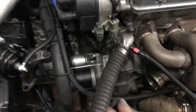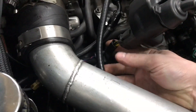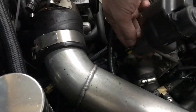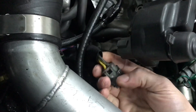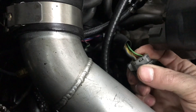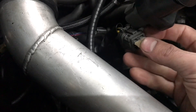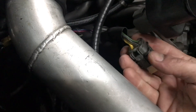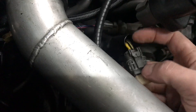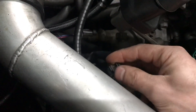Essentially what we're going to be doing is disconnect these two plugs here and disconnect the distributor. Back here there's a plug for your coil and you have to disconnect this plug as well. That plug has very thick gauge wires — it has the green wire, a black wire with a yellow stripe, and then a large yellow wire. You take this fuse and shove it into the top of the jumper harness here, because you need to run power from this side to that side. Now that it's all jumped in, I'm going to wrap this up with electrical tape and move on to the rest of the install.